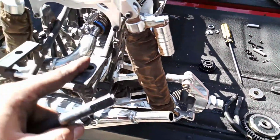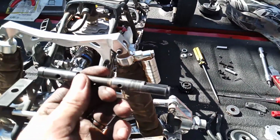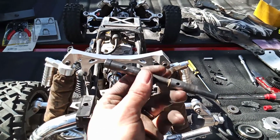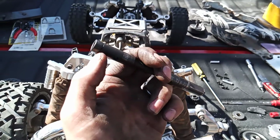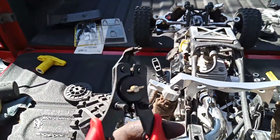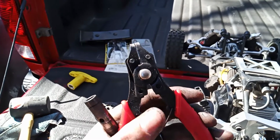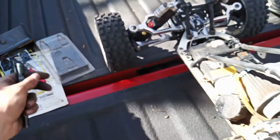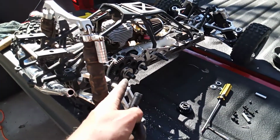So you have to pull your transmission out. You have to pull out your stock shaft, which sits like this if you're facing from back to front. This shaft sits inside. There's a gear pin, then there's a gear, and there's a clip that you need these pliers right here to do. See how it has the little pins, and when you squeeze it, it spreads the clip open. That's what you need to do this 2-speed or 3-speed, either one you choose.